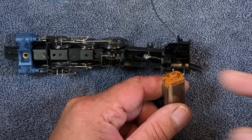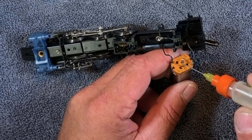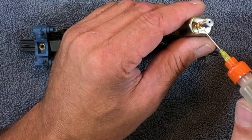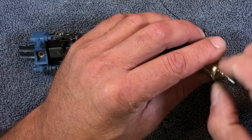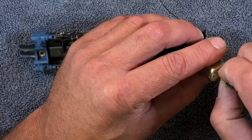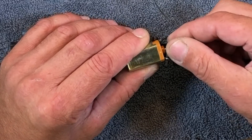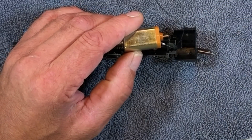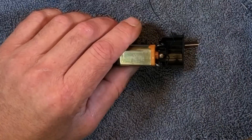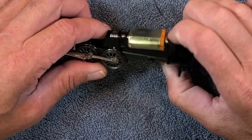Since we're here, I can't open up this can motor to service the brushes, but we could put a little oil in it — just a little taste, just a touch, just a peck, a little bit less than too much going down in there. A little bit up on the front of it — that's all she can have. We got these bearings holding on to the armature shaft, very neat, simple design. Put a little here, put this little bearing back on — I kind of like that, makes it meatier, it's got some beef to it. Get that clip back in there, she snaps in.